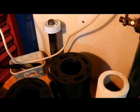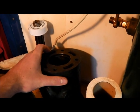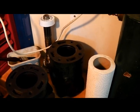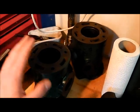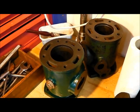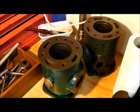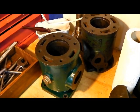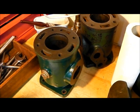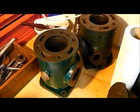I thought I'd solved the problem — I found this cylinder here with a standard-sized piston. The ring lands are in quite good order and the piston itself would clean up, with a decent gudgeon pin. However, cleaning it up revealed a nasty crack right through the bore, which is such a shame. So I'm back to the original cylinder. Because it's been bored 20 thousandths oversize already and has about 20 thousandths wear, it would really need to be bored plus sixty.